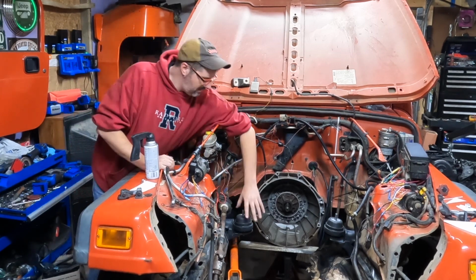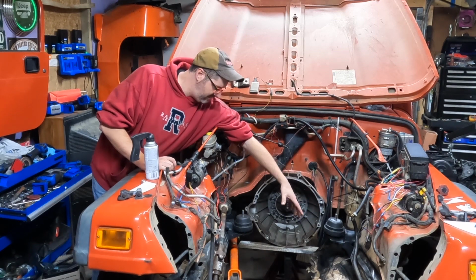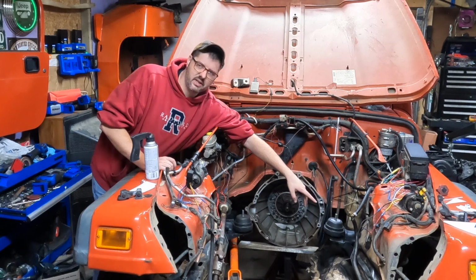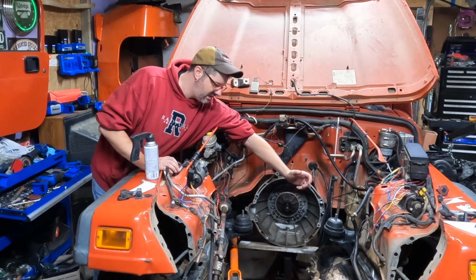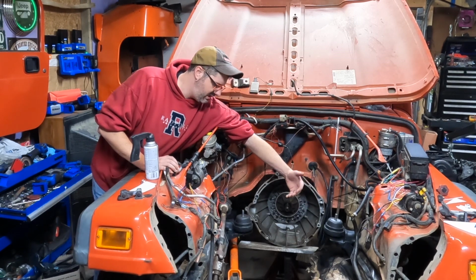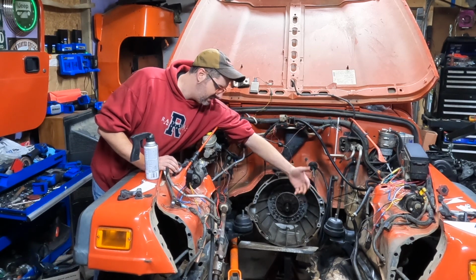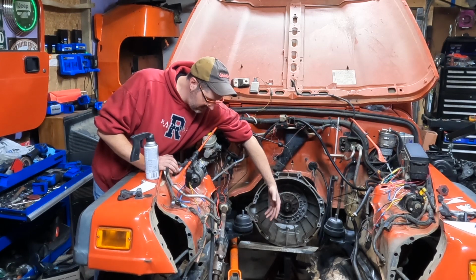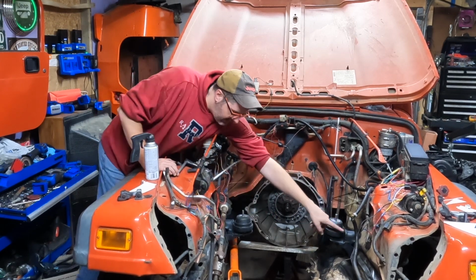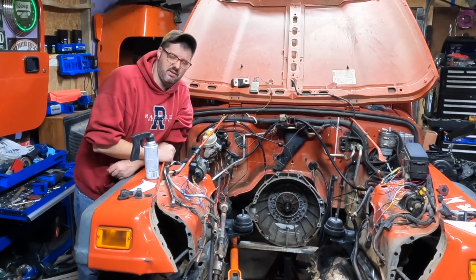And I went ahead and put my hydraulic motor mounts back on the frame mount perches that I had welded onto my frame. And looking at it, I'm realizing I can add one more gusset to each side, which I think would give both of these frame mount perches a lot of rigidity and structure, so I wouldn't have to worry about them bending. So even though I painted these a couple hours ago, I'm going to add a gusset here and a gusset on the back side of this one, just so I don't have to worry about it.